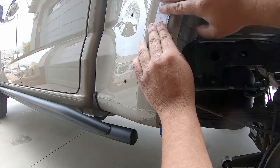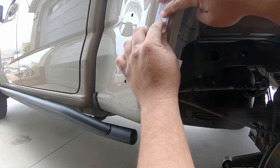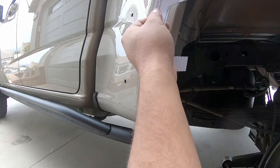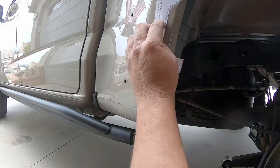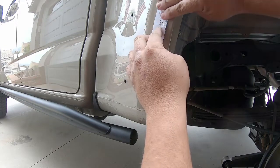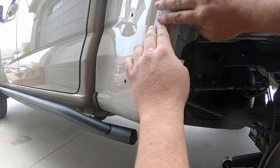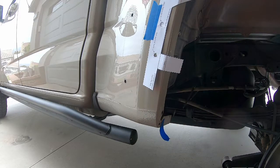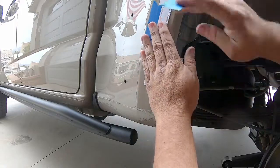You can use your finger to find the center point and get things aligned. If needed, pull it back up and lay both pieces down so they're nice and flat. It's critical that the template is flat — any bends inside will change the curvature of your cut. The cut is the most critical part here. Once everything is locked in place and you're comfortable, put some tape down to lock it in so you can create your actual cut line.